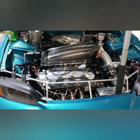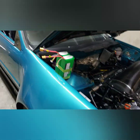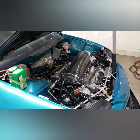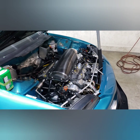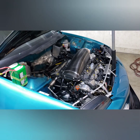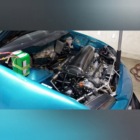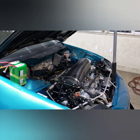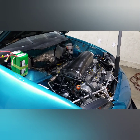Steve P had asked for a little bit of info on 16 volt and why you would do it. Mostly it's the electric fuel pumps. Your coils run a little bit better because they're running 16 volt. Your injectors — it's a little more constant, there's less fluctuation. It does drop, so you need to be on the ball when you're tuning it. But most of our cars don't run long enough for it to be a big deal, and we're not driving in traffic or anything.